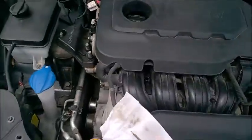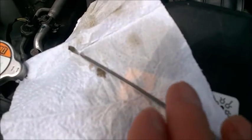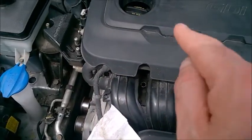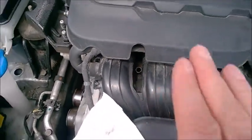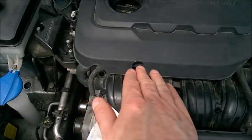Make sure you have the letters at the top like this — not the other way — because sometimes when you remove it, it will show a long smear on the other side that looks like a higher oil level. That's why I read it with the markings at the top. You read only on the reading side, not on the other side, because the other side gets smeared with oil from the dipstick tube. It's confusing, so just make sure you read on the correct side.